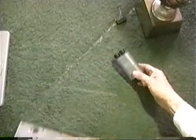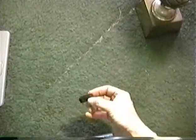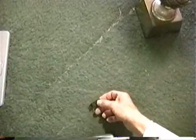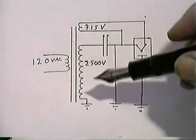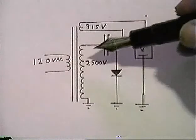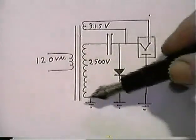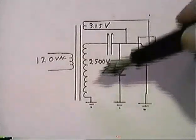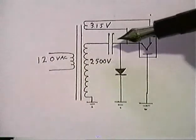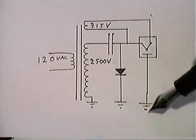In addition to the transformer, there is a voltage doubling capacitor and a diode that you will use. The power supply on one half of its cycle from the 2500 volts charges up this capacitor through this diode to ground. In the next half of the cycle, the capacitor is in series with the transformer windings, putting approximately 4500 volts to the magnetron.